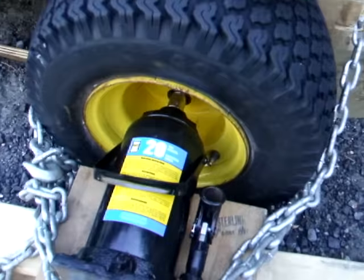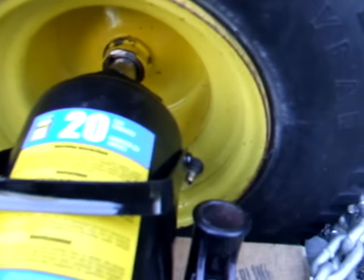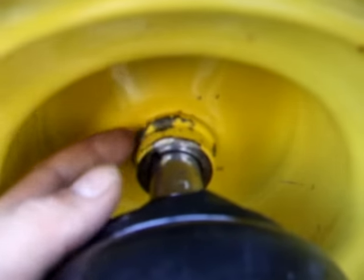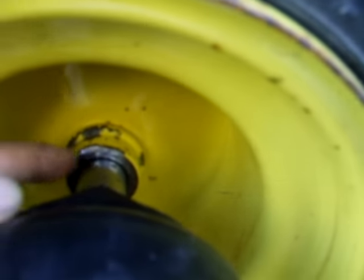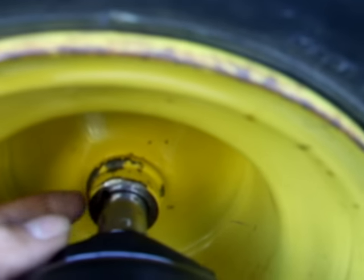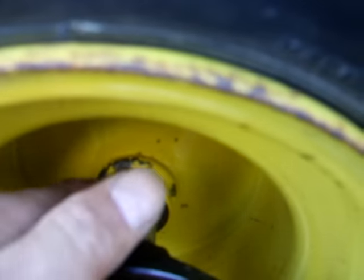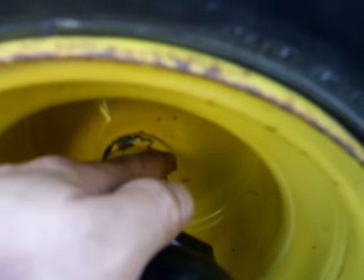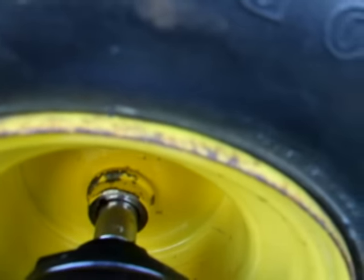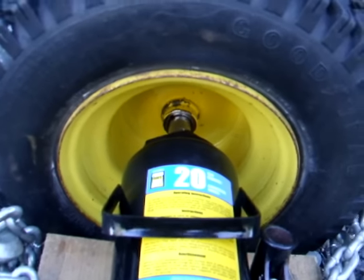When I get back to the house, I'll show you one other method that seems to be a real last-ditch effort. The beauty of this main method is you don't have to damage your rim — no drilling or welding. But if this doesn't even work, one guy came up with a last-ditch effort: drill a half-inch hole right near the hub, get a sawzall, put it through the hole to near the other side, and saw a slot right in the hub down to the axle. He says do it over the keyway so you won't cut anything. With a slot all the way along the hub, you can get oil in there and a cold chisel, bash it, relieve the tension, spread it apart, and get the wheel off. The good part is you can still use your wheel later — so what if it's got a slit in it? You're not going 60 miles an hour. It'll probably outlast the rest of the tractor anyway.